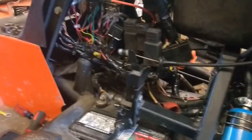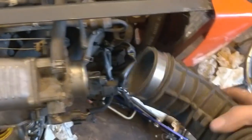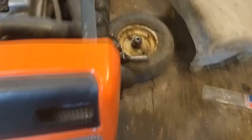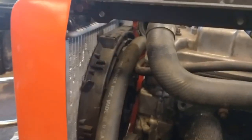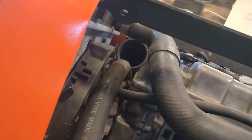This is the original intake boot, and it's backwards — so if there's a little bit of play here I can make that up. It originally went the other way, but this actually works out really handy, putting it right in line at the front of the motor. I'm thinking of running a straight piece — I can get away with two and a half inch charge pipe in there; two inch would be fine for this boost level and engine size, but two and a half is what I've got.